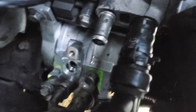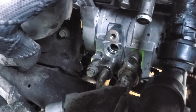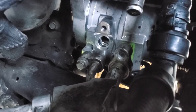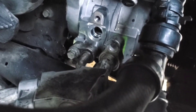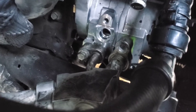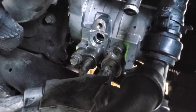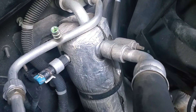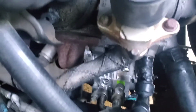I've already filled the compressor up with oil. This truck has rear air, so the internet says it requires 11 ounces of PAG oil. I bought an 8-ounce bottle, and the manufacturer already oiled the compressor with 3 ounces — three plus eight equals eleven, so we're at the required amount. I put new O-rings on, and once I get done I'm going to replace the accumulator, because you have to replace the accumulator to get a warranty on the AC compressor.